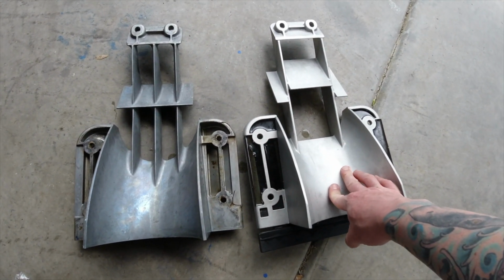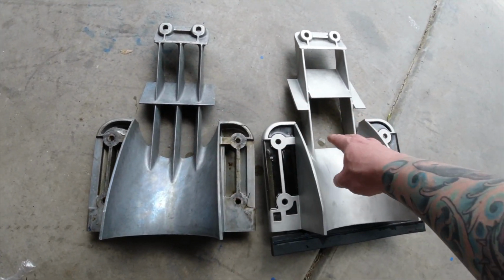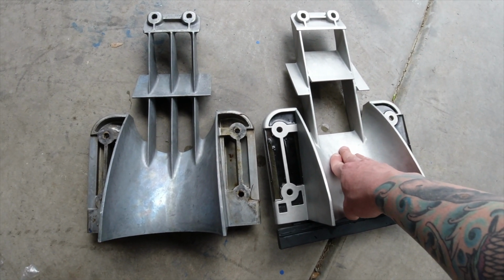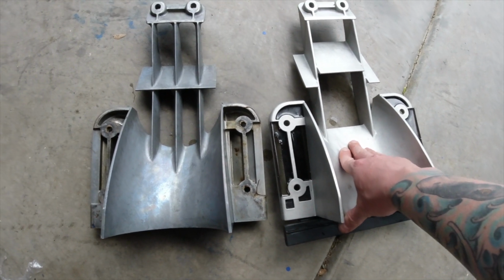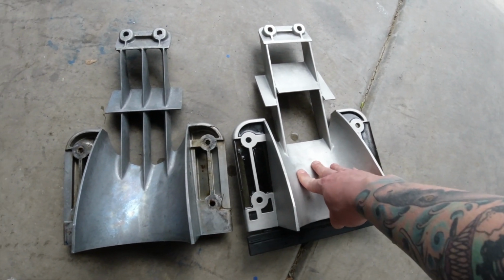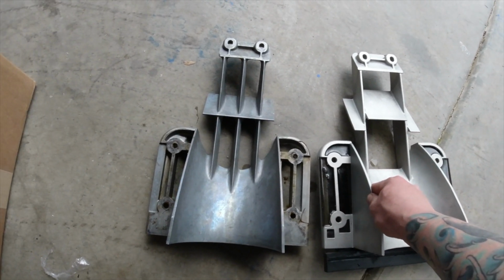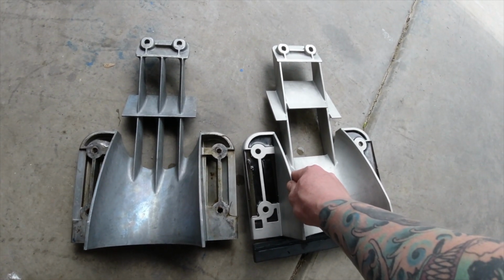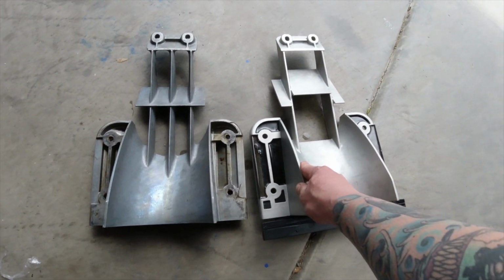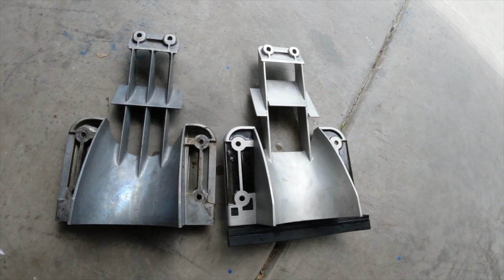The one thing you've got to think about when you do change the intake grate is that the stock one stops a lot of big objects coming in. Now with this being more wide open, you have a better chance of something coming into the jet pump. So just think of that before you do all this kind of stuff. It will stop a lot of cavitation, but this will allow a lot of pieces to come in, pretty decent sized stuff, even the size of a decent sized fish. So just always be aware where you're riding that could happen and cause damage. But this is it. Let's get it all put together.